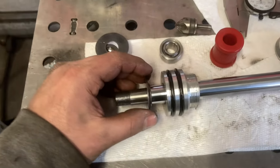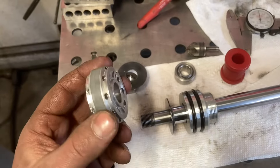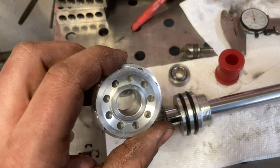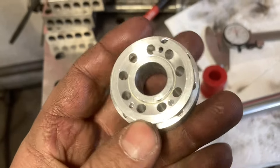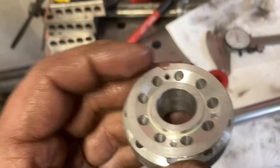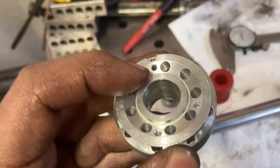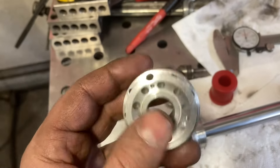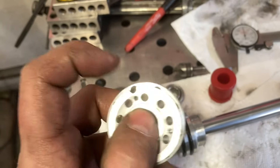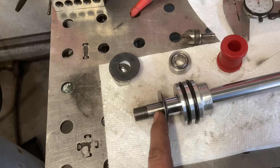It just felt kind of tight and rigid. This is something I've done with mine. I called the guys at FOA just to confirm — they had me drill things. You've got the large holes, and then there are these three smaller holes. The small holes are free bleed holes, so the oil is able to go from one side of the piston to the other without having to act upon the shim stacks. They came with one and he recommended drilling two more.